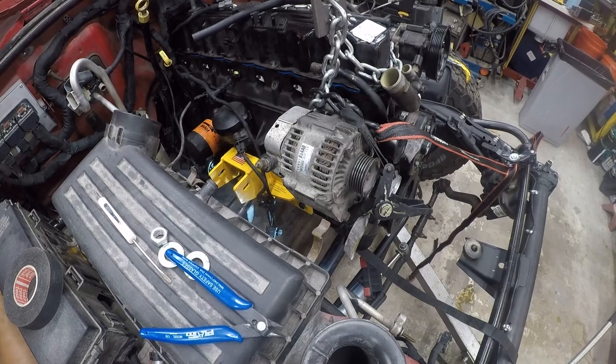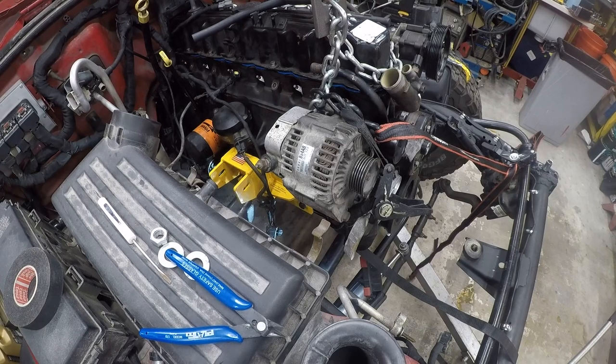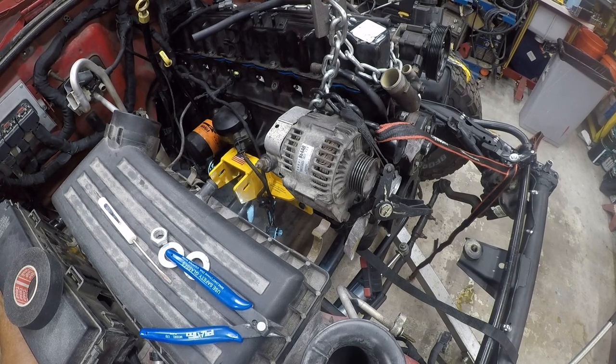I mean, that's the other option, is get the rubber out of here. And I don't know how you do that, but if I took the rubber out, I could just weld an extension onto this and be done with it. Refabricate this mount. So I think what I'm going to do at this point is I'm going to stop and send some pictures to Brown Dog and just see what they think the lesser of the available evils are. This is clearly a frame alignment issue.